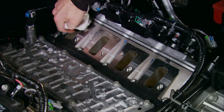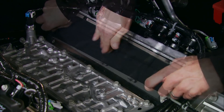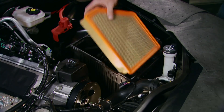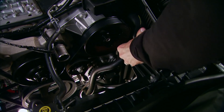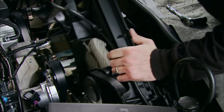Here are some important steps: vacuum the valley cover and clean the heads with alcohol or a similar solvent to eliminate oils and residue, then cover the ports with tape. Remove the air box and filter but save them for later. Then disconnect the radiator hose, leaving the T-fitting intact and moving it to the side, then disconnect the fans and pull them out.